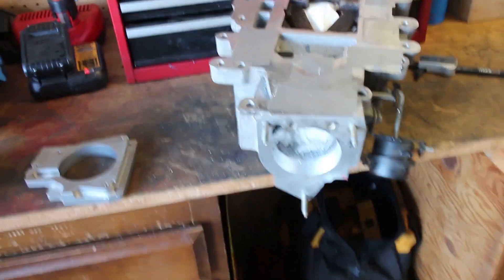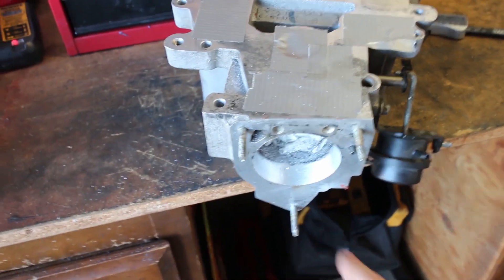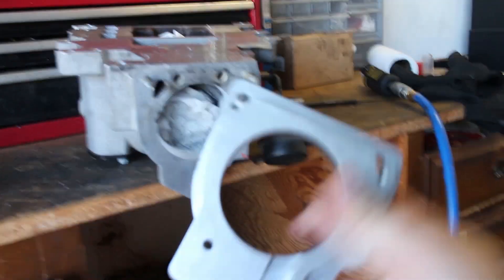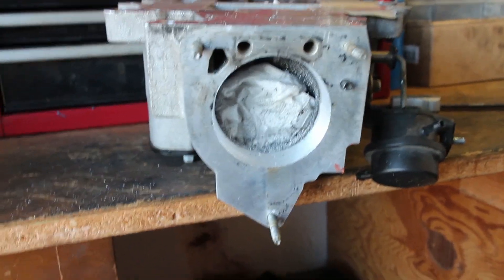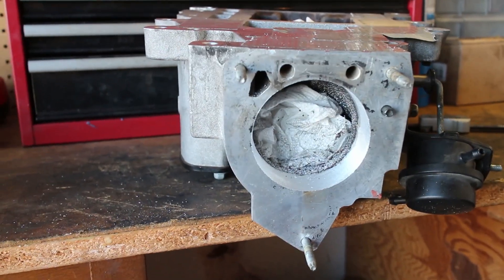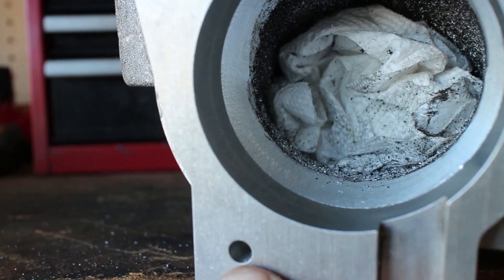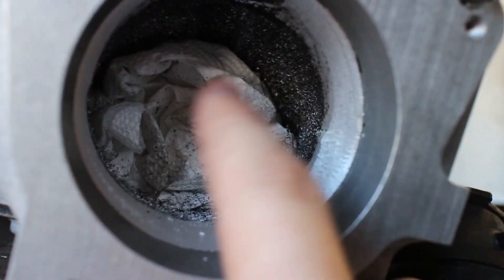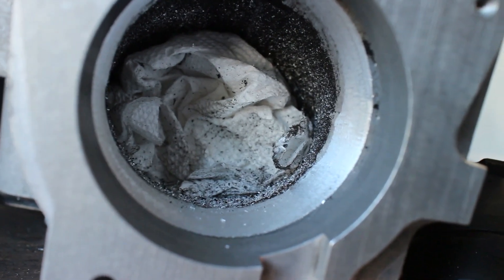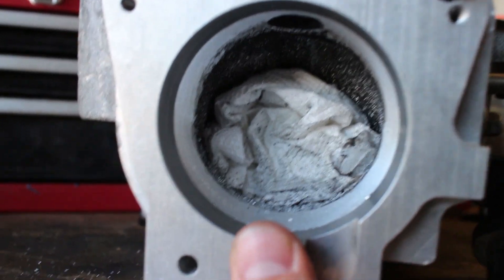I just got reminded I needed to do some porting on the actual inlet to the supercharger. Basically the supercharger here is 72 millimeters, and it needs to be bored out to 75 millimeters for this V8 throttle body adapter. The adapter is not going to go on this plate, but I just used it as reference. We're going to be putting that steel plate on here with the 180 degree piping. It fits up pretty well — you can see that it makes a perfect seal all around. I'll probably go in and do a bit more smoothing, but it's right at 75 millimeters now. Got that done.